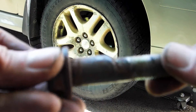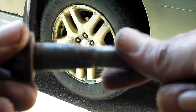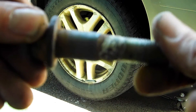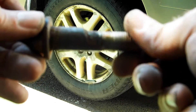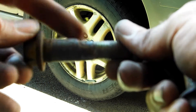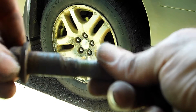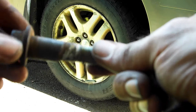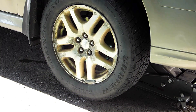Here again is the top bolt. If you can see, there's a thicker part on the bolt - it's not completely round, it has a shoulder on it. As you turn it, it has a cutout in it. That's what adjusts the proper camber - the wheel tilted in or out perpendicular to the road. That's why it was important to mark the bolt orientation before removing it, so I could hopefully put it back the same way.